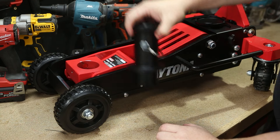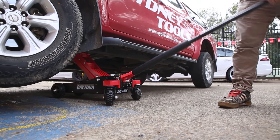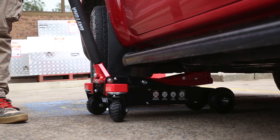Both those included nose pieces have grip heads to minimize slip, and they've also got 360 degrees rotation for easy location. If you haven't used a trolley jack before, it's as simple as ensuring you're on solid ground, locating lift points on the vehicle or trailer, pumping away, and then just twisting that handle to release when you're finished.